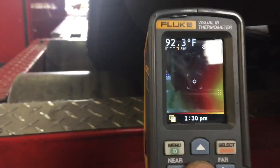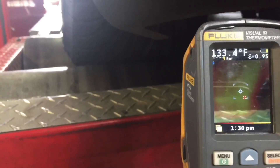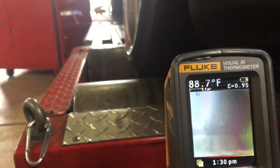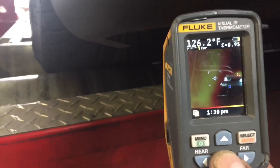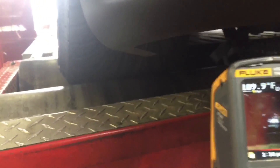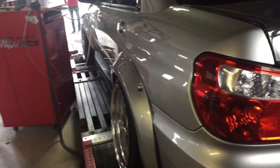It's been sitting for a minute cooling down, but let's take a look at this because I'm very curious. Right here — what's that glowing thing? That is the tire. It doesn't even seem to be too terribly hot, but as you can see it's 134 degrees on the inside, and as I move over to the outside of the tire it's about 80 degrees. A lot of track racers use thermal cameras to gauge alignment and traction. You're basically giving up most of this tire — you might as well have a 185 on this car for the traction it's giving you.